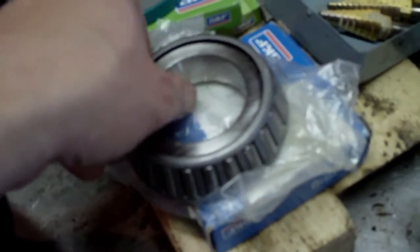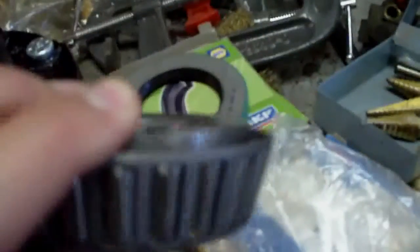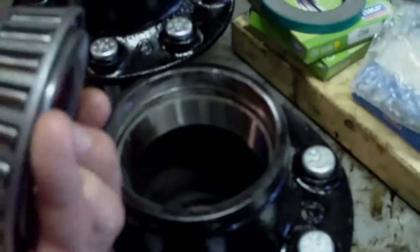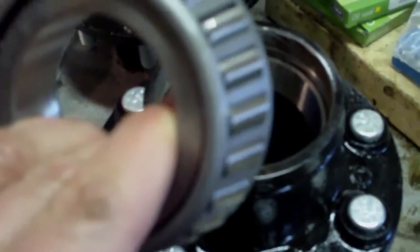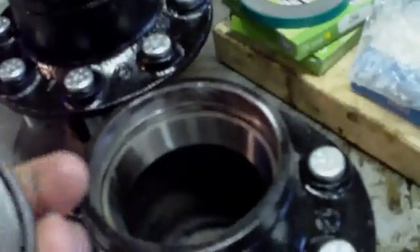I did a little bit of checking, just answering my question from yesterday, which was whether or not to pack grease into these bearings or just soak them in oil. The consensus of opinions was, even though it's oiled from the diff, pack it with grease anyways — the oil will wash out the grease regardless. It'll provide some good lubrication until the oil gets to these bearings, and at that point the oil will take over essentially.